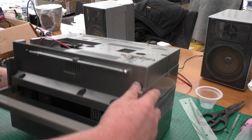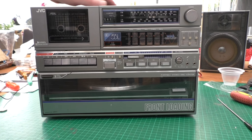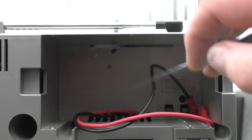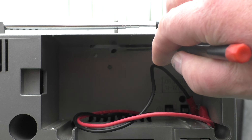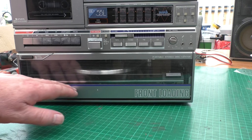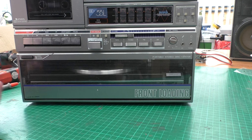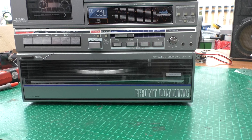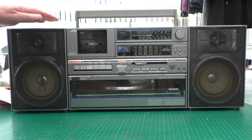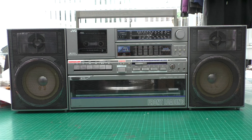And it's all back together. One of the nice things they've done - if you look into the back of the unit where the brick would normally be, there's a small cutout where you can adjust the motor speed for the cassette player, which is quite nice. To adjust the turntable speed, when you eject the tray out, just underneath there are two small screws which you can adjust for 45 and 33 RPM. JVC DC 33L - fully functional now, fully repaired. What it now needs is somebody to take it on and do a little bit of renovation and cleaning.